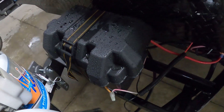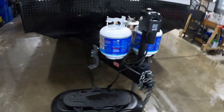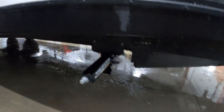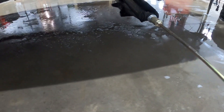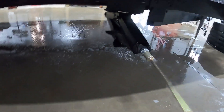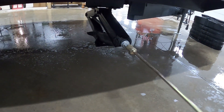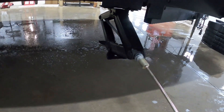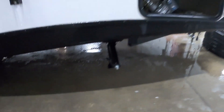Speaking of power, check your battery posts every now and then to make sure nothing's going wrong on the road. Once the unit is level, the next thing to do is stabilize it. All four corners have three-quarter-inch stabilizing jacks — you'll find the handle for them. You can use an impact driver or drill gun; I just recommend slowing down when you get to the bottom. I also recommend stabilizing jack pads to protect the feet from dirt, debris, and sinking into hot blacktop in the summer. Run them down until they're taut, get all four down, and the unit is level and stable.